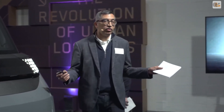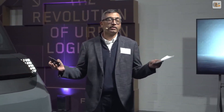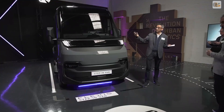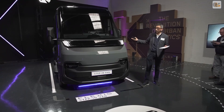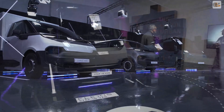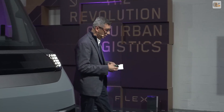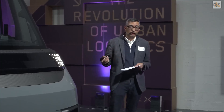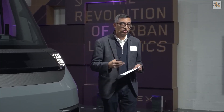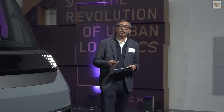We closely studied North American vans that have completely optimized the B2B world, but we wanted to bring all the attributes needed for European streets. The second priority is scale of operation — as you can see, all three vehicles have common parts across them, allowing us to run production in a flawless manner. Key elements we put into this vehicle include driver ergonomics: we looked into exactly how the driver needs to be positioned, the H-point, so the driver is able to have a fatigue-free working life.